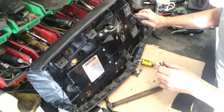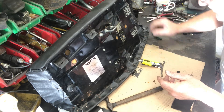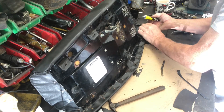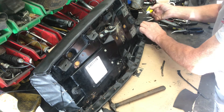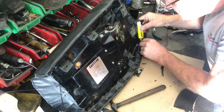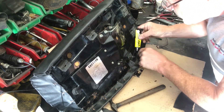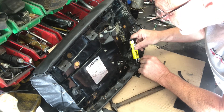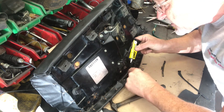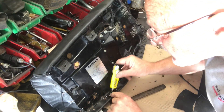I've got the seat fitted to the base now and most of the excess cut off. You end up with one or two folds like this, but with impact adhesive, what I'm going to do is work my way around here and put a little bit of impact adhesive on — give it a minute to go off. Don't try and make it stick straight away because it won't. I'll put a little bit under these bits and work my way along. I'll work around that buckle hole there — by the time I've cut around it, this will be ready to stick.